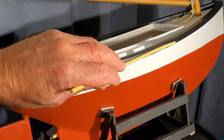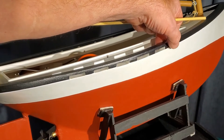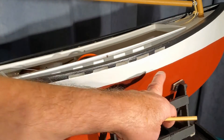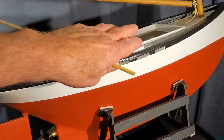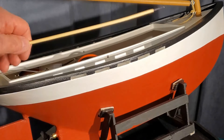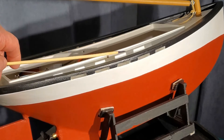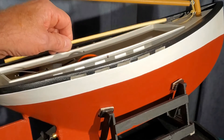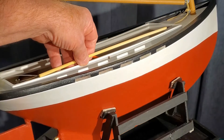Another modification I did up top at deck level is I raised up the railing. It now measures about three-eighths of an inch high total, but I chopped out spots for scuppers. I'm glad I did because this railing was underwater quite a few times. At one point I even took a little bit of water below — it didn't damage anything. But anybody who does experiment under sail would want to make sure that the hatch opening is quite small or sealed in some manner.